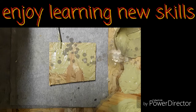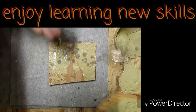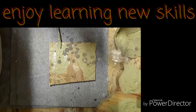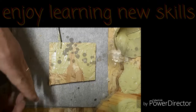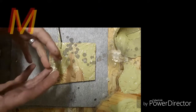In my next episode, I'm going to show you guys what happens when you're mixing resin with this product. When mixing resin with this body filler, it basically strengthens the product. You also get where you can make a paste. We use this product with resin with fiber strand. The fiber strand you basically cut into small pieces, you mix it together, or rather just break off the strand into a lot of strings, like a wool sponge, or basically like cushion wool, and you just mix it together.